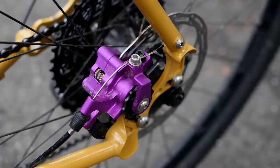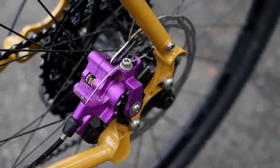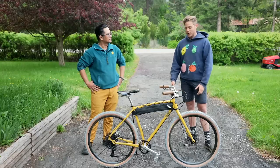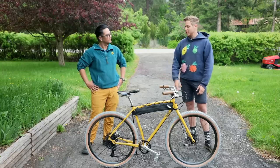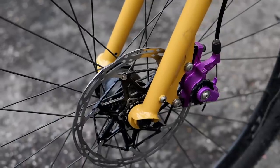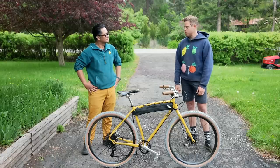Okay. And then just the way you have to adjust those brakes, like from the bottom, ISO just works really good. And if you have a brake like the clamper like this, you get the short pull levers, the short pull brakes, and I have a set that has been on like 6 different bikes. ISO works with pretty much everything post mount, and so it's nice for people who want to move nice parts around to different bikes.